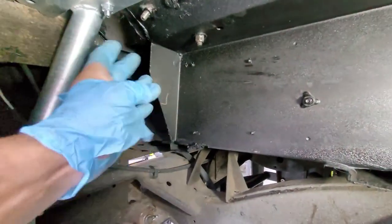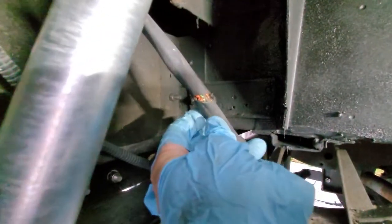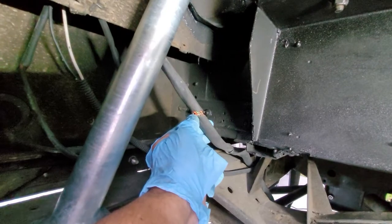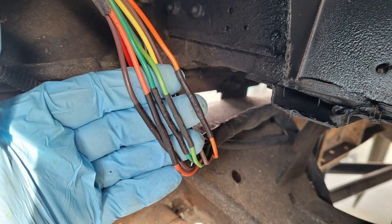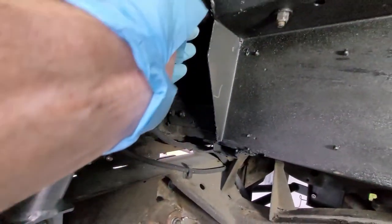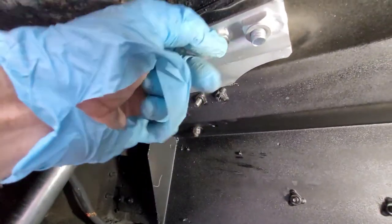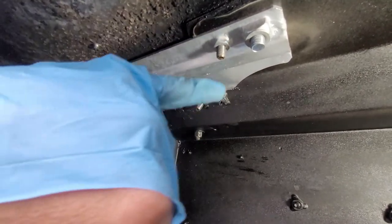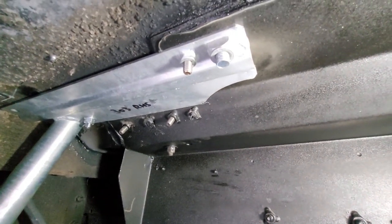I could also put another one in the back at a later time — I don't have to remove anything for that, just drill it through and follow through on the other side. But there are too many wires right above that area that I didn't want to risk. As it is, when I was grinding away this stuff I chipped these really cool trailer wires running from the front all the way to the back, including the brake lines. So I cut a bunch of these — I'm going to open this up, use non-insulated splicers, seal them up with heat-shrink tubing individually, then wrap it all back up. I'll also put a protector coming all the way down here to protect this area from any future harm. Then up here, this is another locator nut that's welded in place — it's an M8 — and this is the bolt that comes with the little L-bracket in the seat belt kit from Safari HP. Thank you, Steven.